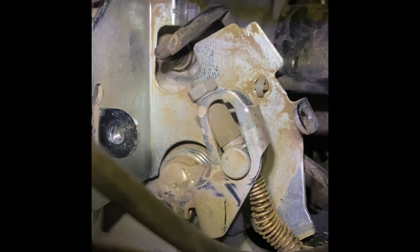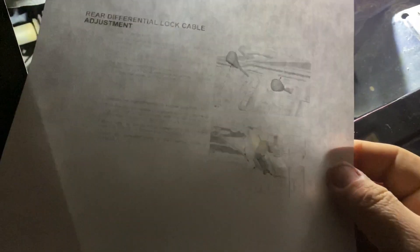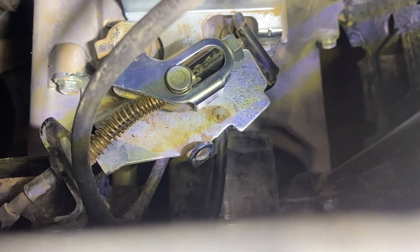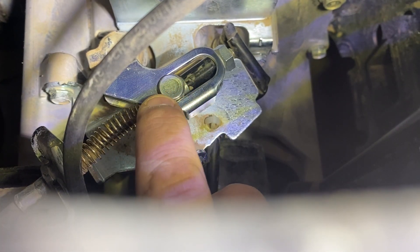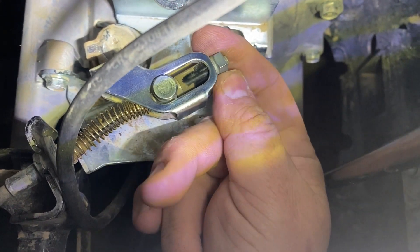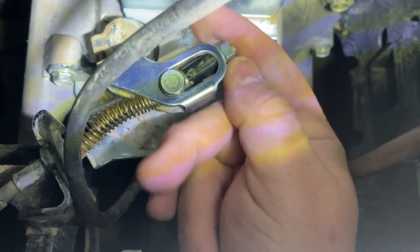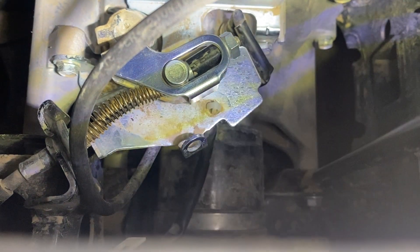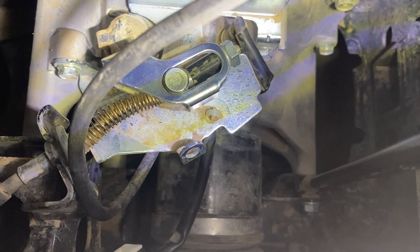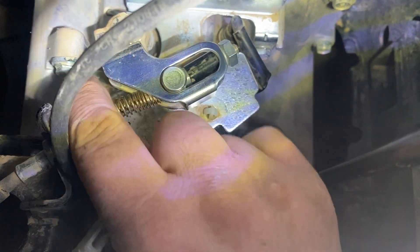Here's an excerpt from the service manual — I'll put it on screen so you can get a better look. The instructions on the top of the box are still accurate per the service manual: put it in park and turf, then snug down this little fitting to take out the slack. Then back it out one click so you have just a slight bit of slack. The specs say between 0.25 millimeters and 1.5 millimeters of slack between these two points. I still have a little bit of slack right there, so that's perfect and correct.